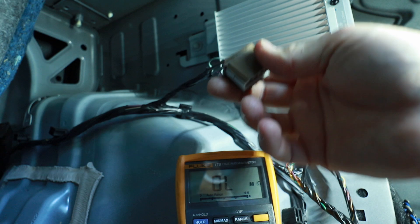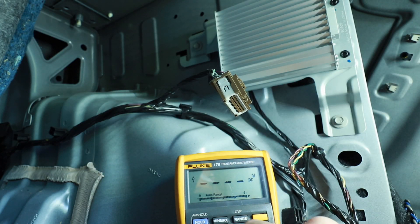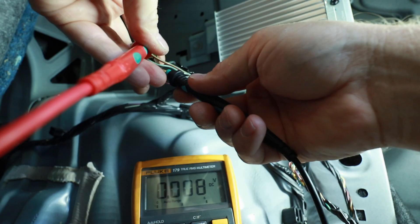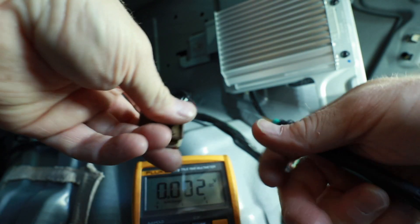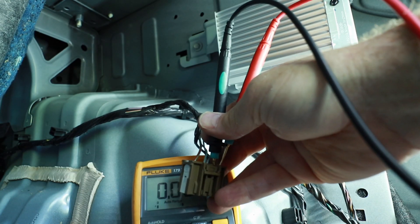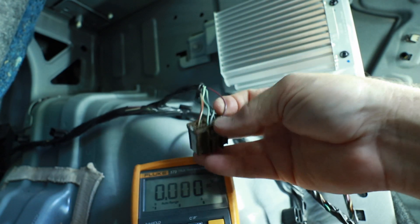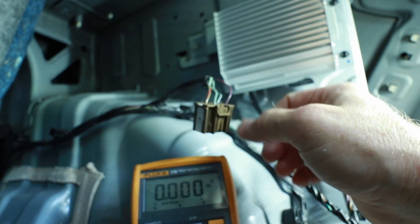The other plug has five wires - a twisted pair, two fatter wires, and a rogue purple wire. We'll set our digital multimeter to DC, which is the line with the dashes beneath it. Connecting the ground test lead to a ground and what I think might be positive, the meter shows 12 volts. Connecting to what I think is ground confirms power and ground. I believe this little purple-red wire is the remote turn-on. However, most remote turn-ons for Fords are six volts - really not going to do us much good. With the car on, it is in fact six volts. If we were going to use this, we could use something like a TR4 that has a six volt to 12 volt trigger on it to activate our output. But we'll wait and see what else we're dealing with.